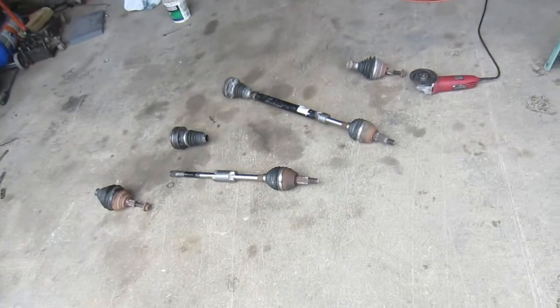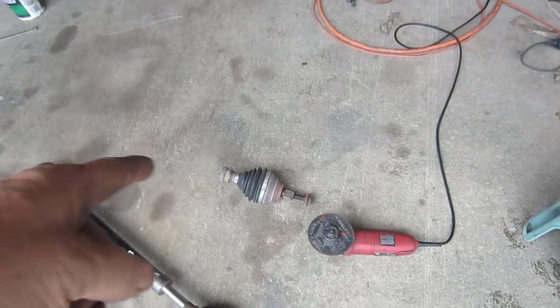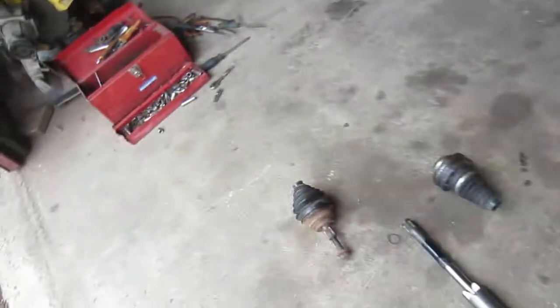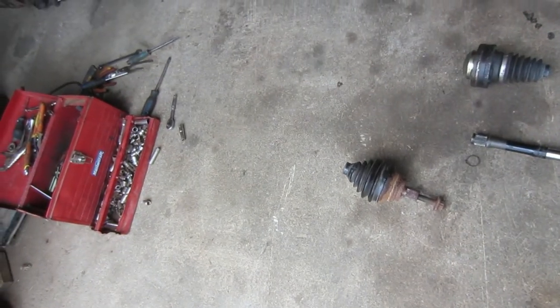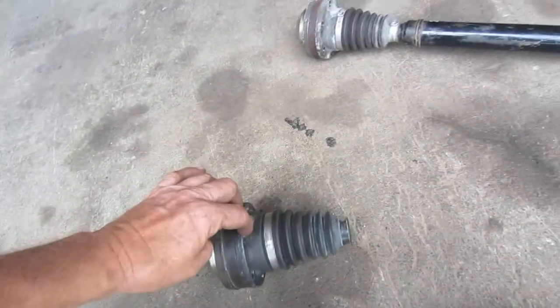Here's how you make your axles. First thing you do is cut the ends off — you don't need them anymore. The VW ends — using a cutting wheel grinder. You can always save those and use them to fix up a bad CV shaft if the boot was broken or the CV joint went bad.